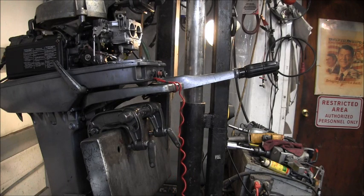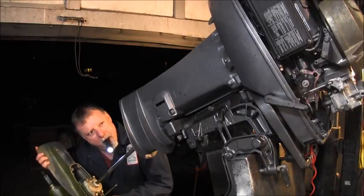That's how I'm going to do that, because I got a bucket full of the OMC clamps, but I don't have any Yamaha that size, so I just give it a quick tap. Then when I take it off there, I can put the cups on by bolting them with a 7/16 inch bolt. But I'm going to paint them cups first. They're kind of rusty. Or I'll look and see if I got some stainless ones. But there we go. One step.